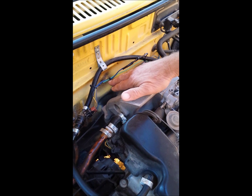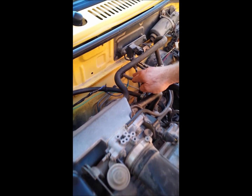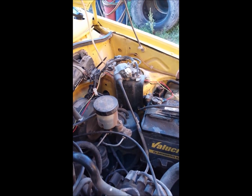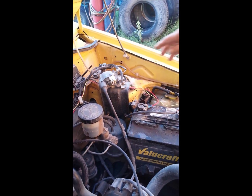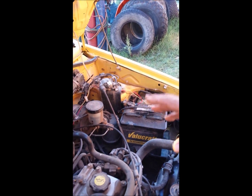The two wires coming out: you have 12 volts, which is tied to the blue wire, and then the green wire is a pulse wire which fires on the ignition pulse. Both of those go into the firewall. The yellow wire is the trigger wire that activates when we turn the key on, the red wire is the positive side, and the black wire is the negative.